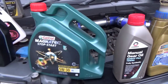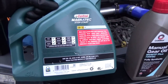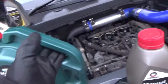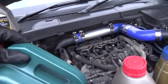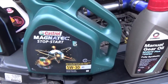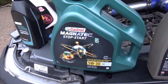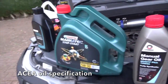So that's the oil you need. It does meet some sort of Ford standard — there's a Ford thing on the bottle. These engines are PSA engines used on Citroëns, Peugeots, Fords, all sorts of cars. It's a Ford oil standard that is designated by Land Rover, but you want the 5W30. This A5 is a newer numbering scheme — they have codes like C3 and A5, it's just another code for the grade of the oil.